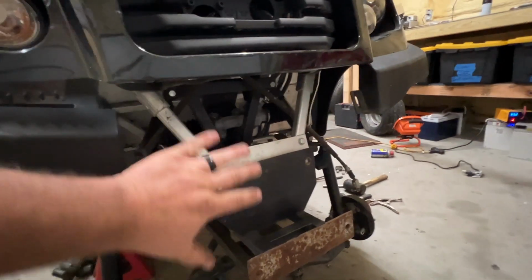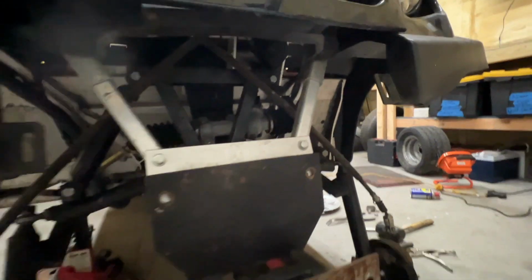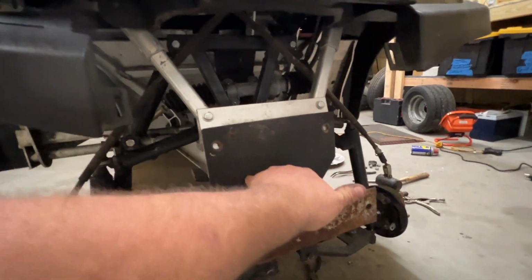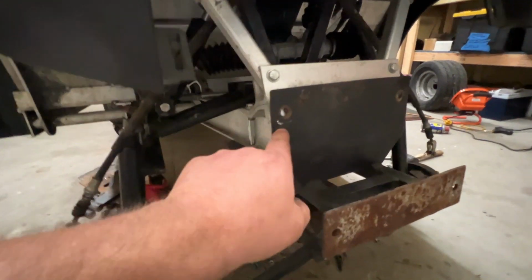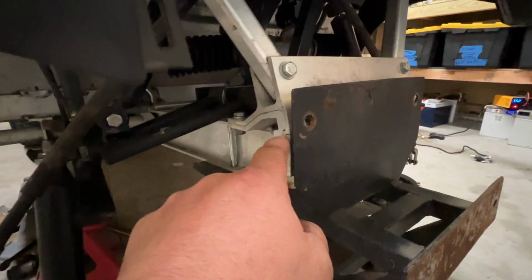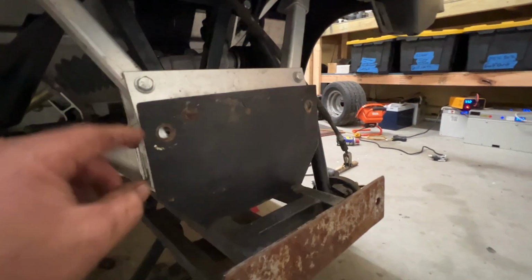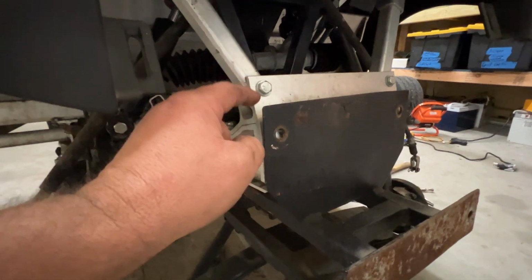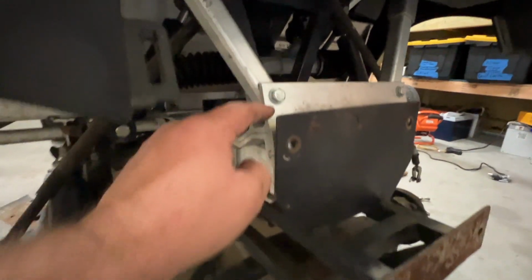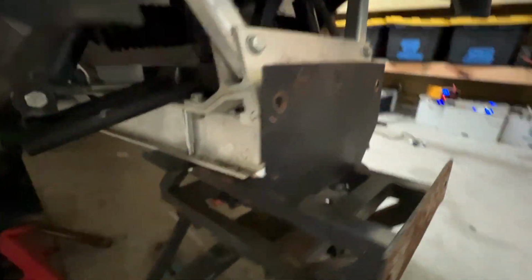Now on this front bumper here, it's got 2 upper mounts. They're up in there, one there, and one there. There's 2 lower mounts right down in here, okay? So what I'm gonna do is take this front plate, where it's got this little crease out right here. I'm gonna mark a line from there over, cut that off. We can then use the bolts that go into the bracket here that holds this front bracket and the side bracket here. We can put those back in.